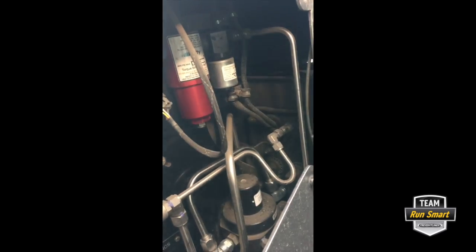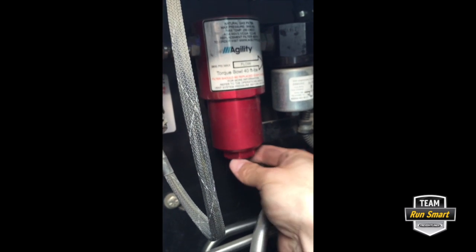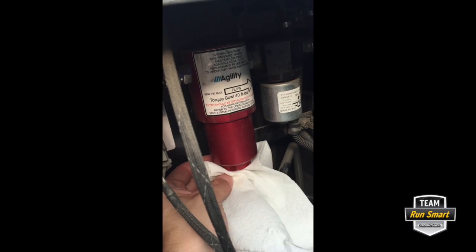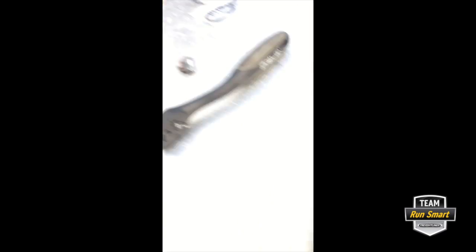It's open all the way, so it did a good job — that means the system is now fully empty. Down here on the bottom of your high pressure filter is your drain valve, and that's where we're going to check for any moisture coming through. We have our eleven-sixteenths socket. Open that slowly. If you've been fueling at good stations, you shouldn't have too much coming out. This is recommended every 1,500 miles, with increasing intervals depending on how much you get.